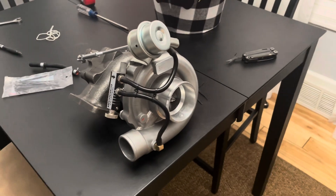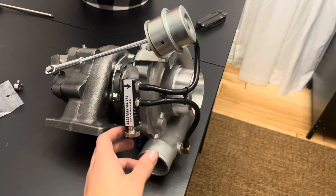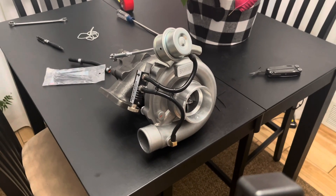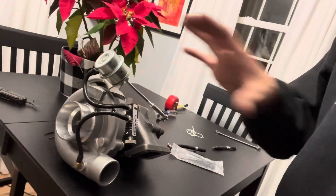That's pretty much a wrap for the boost controller install — bracket making, whatever you want to call it. I'm really happy with how this turned out. I'm already filming a video of installing this new turbo and getting the old one replaced, so hopefully we can get this in and test the boost controller. I've got a boost gauge all hooked up so we'll be able to tune it a bit. For anyone with questions about plumbing boost controllers: it's super simple — boost supply goes in, and the out goes to the wastegate. If you have an internal wastegate turbo like this, you can tap into that line, mount the controller right on the turbo, and if you ever need to take the turbo off it's all one piece.